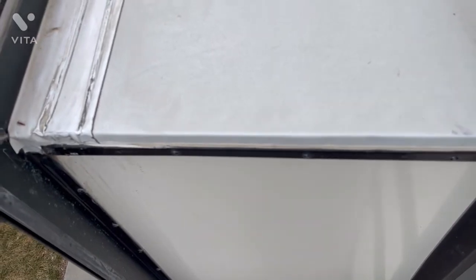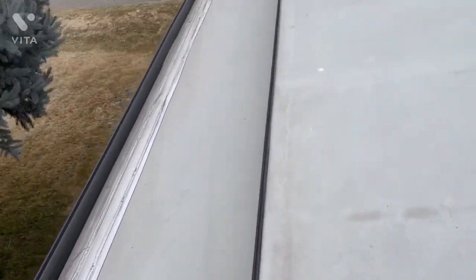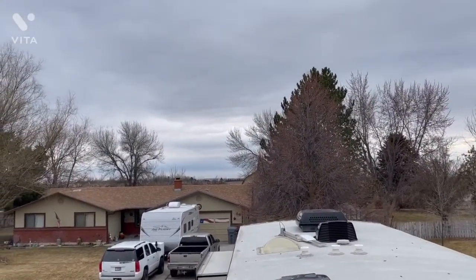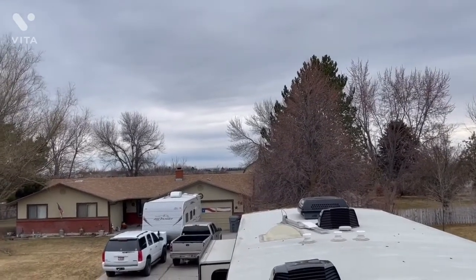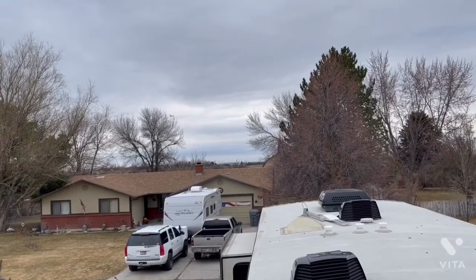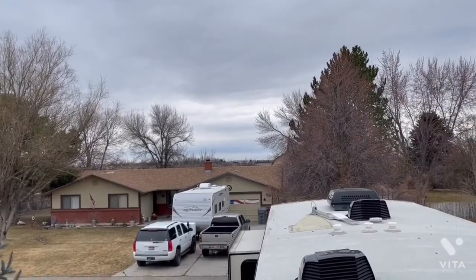Just wanted to give you a heads up on these slides and hopefully I've answered any questions about the drip strip on the back edge and front edge of your slide-out wall — it's about an inch or two down from where the TPO roof membrane wraps over and is held in place by that drip strip, which is of course sealed. That's all from the offline guy for today. Have a good weekend — hope the diesel fuel prices don't continue to go up. Take care.